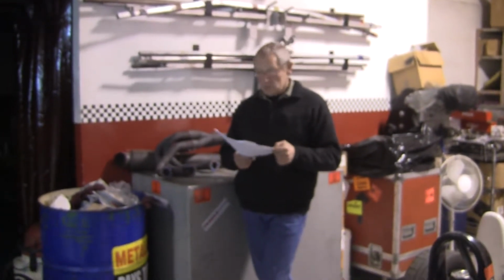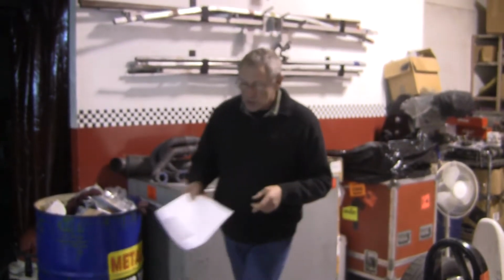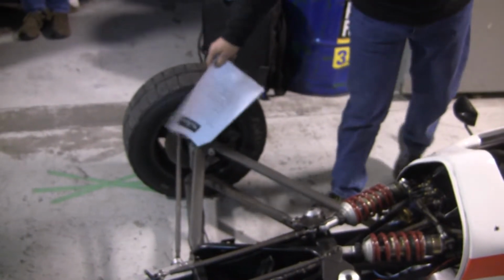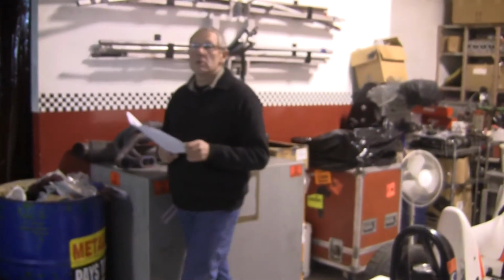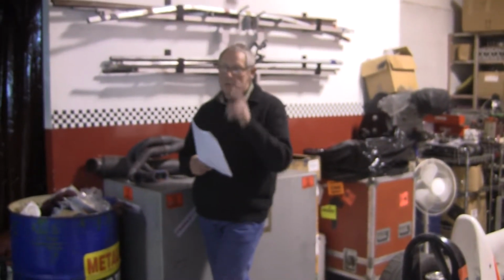The toe out is a huge adjustment. The toe out is a very coarse adjustment. Yeah. I mean, these cars are so short in here, and the racks are quite slow relatively. One turn of that push rod, of that toe link, is about 6 millimetres. So it's a very coarse adjustment. Be very careful with it. How much toe in on the rear do you have? 1 millimetre more. Each wheel?